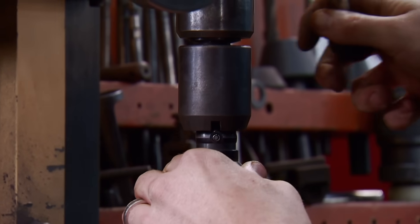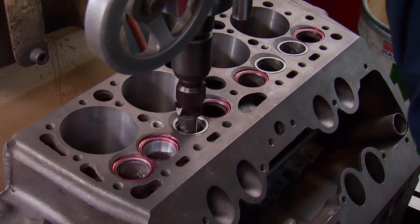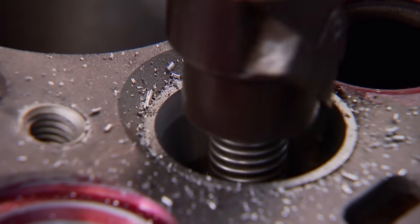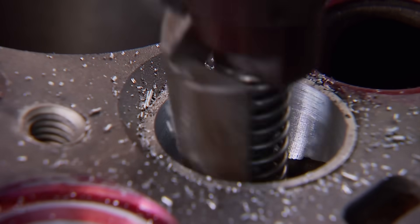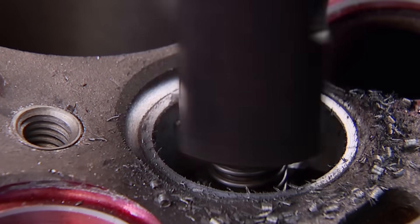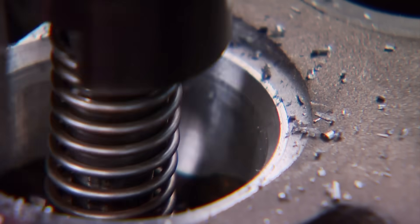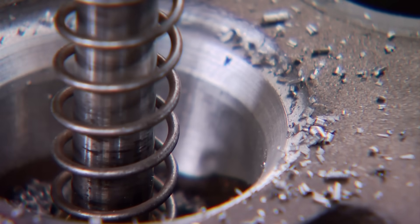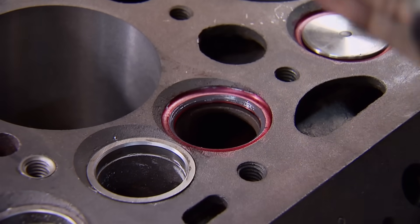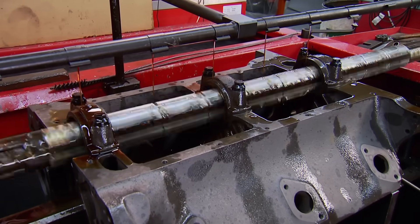Now we're ready to do the valve job, which could make or break this build. I'm just touching up the same size exhaust valve at 1.520 inches. But on the intake side, I opened it up for a 1.620 inch head diameter. To do this, I first need to go into the throat with a 70-degree cutter and make some room. This allows me to fit the new three-angle cutter in. Next, I need to do a de-shroud cut up top — this will help keep the area around the valve clear for air and fuel to move through better. Then I can cut in the actual three-angle valve job for the new larger head diameter. I like to lap the valves as I go — this gives me a clear visual of where the seat area is and how concentric everything turned out. Short of honing the mains and the cylinders, we're done here.